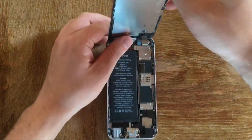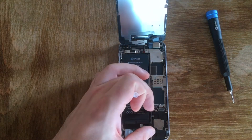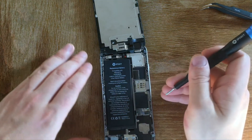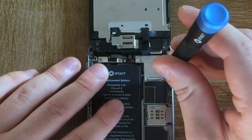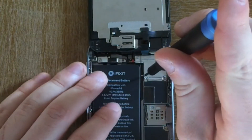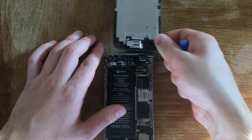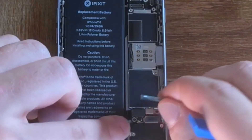Is that supposed to be stuck to this? I mean, it's not really a problem. Let's get to the display so I can disconnect that. Let me get a guide. This might actually be difficult — I have to remove five screws. It's important not to mix these up because they're different sizes, and the iFixit guide says you could cause irreparable damage. Let's actually just be aware of that, and place them in the same arrangement I found them onto the magnetic project mat.